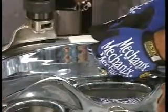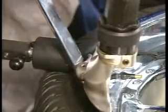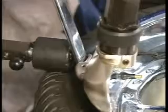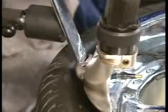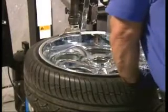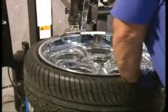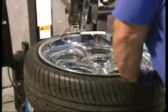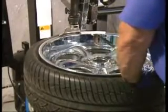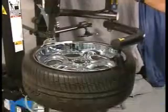Attach the nylon rim protector to the rim lip. Insert the bead lifting tool under the bead and over the support of the mount-demount tool. Lift the bead onto the mounting finger. To facilitate this operation, press with left hand on the bead in position directly opposite to that of the tool. If desired, the bead lifting tool can be removed after lifting the bead onto the finger.